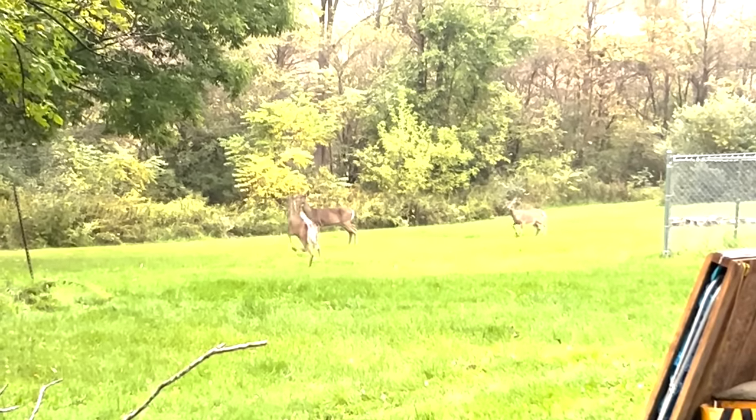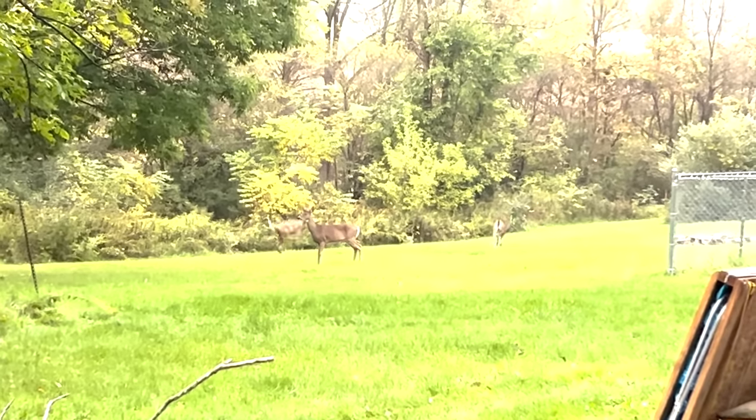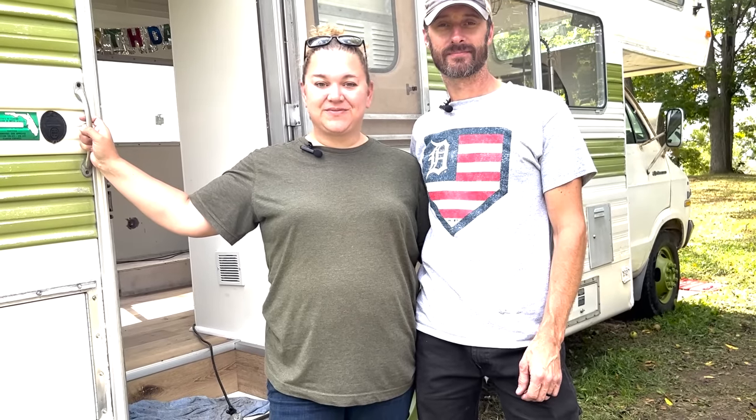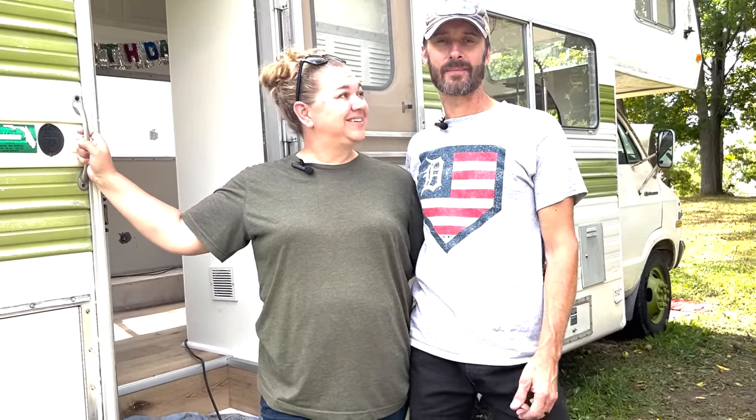All right. So we didn't end up getting to take Harvey to the birthday dinner. We still had a nice dinner. And now today we're going to try to finish up those last few things we wanted to do before that test drive and hopefully go on a squeak-free test drive today. So about the squeak, that's what prevented us. It's the alternator pulley or alternator belt that is most likely the culprit. I've got to space out the alternator bracket, and I'm hoping that cures our issue. Just do a little bit of tightening up here and there, and we should be hopefully back on the road.